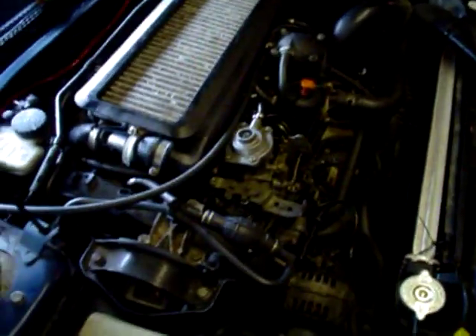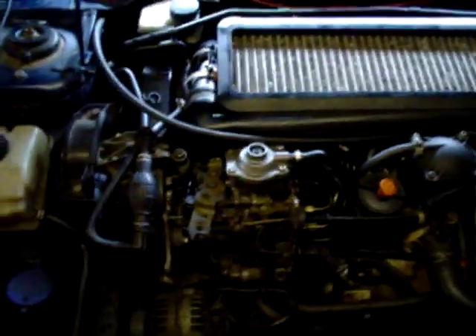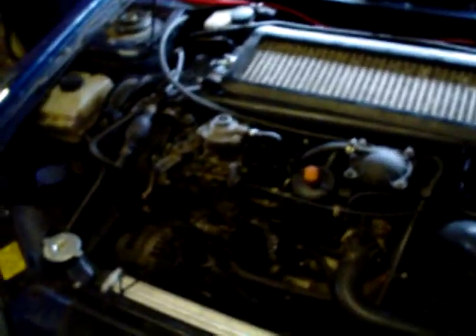With fuel pump settings, the more fuel you give it the more power you have, but obviously the less miles per gallon your car will do, and you're going to be chucking out black smoke, which you don't want to be doing on public roads. So you want to try and get the settings just right so that you've got a decent power-to-economy ratio.